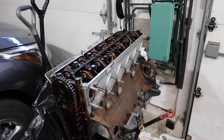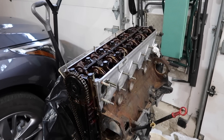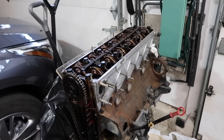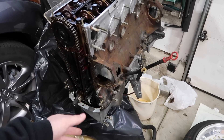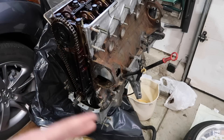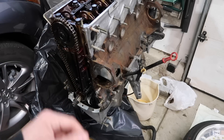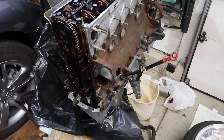You kind of want an earlier M30B35 if you don't get one out of a 635. Aside from that, I've heard mixed things about the oil pan. Supposedly 535 and 735 oil pans don't fit, but other people say they do. I'm guessing they do, but I didn't want to worry about it. So that's one thing you know for sure fits. Otherwise, a B35 is a B35.